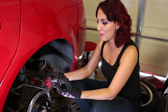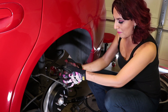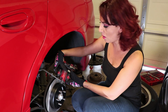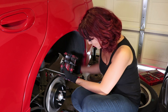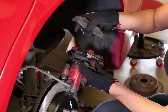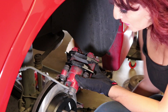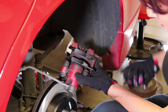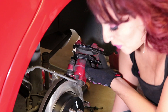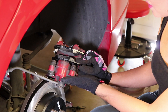Now we're going to put the new brake pads in — this one goes in the bottom. We got the brake pads in; the bottom one was really hard to put on. Wanted to show you quickly the difference between the old pads and the new ones — the surface on the old one is all gone to the point where it started scraping right here, and that's what caused the noise. Now that I've got my pads in, we're going to put the hardware in. There is an orientation to them, but if you do it wrong it won't go in — there's only one way it can go.